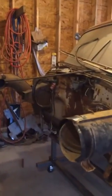There are no repairs there — they're just going to pull everything apart. The dolly I made makes the car pretty easy to move. The side of the car and quarter panels are all fitted. Had to repair this side of the roof here — this was all gone, rusted out, as was this section inside and outside, same as the other side. This has been repaired.